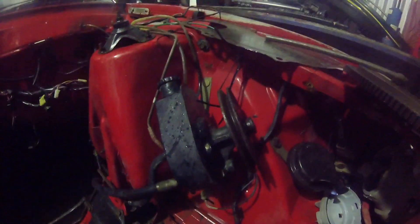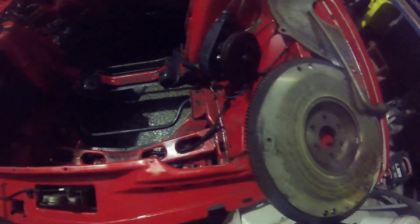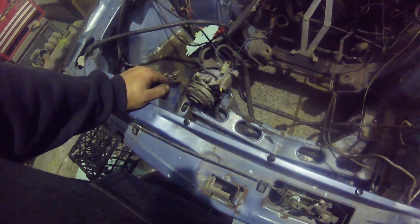We don't need to change the bracket because we changed the engine. The pump just needs to go into the other engine bay, which actually has to sit with an air-con pump. The air-con pump is under the alternator on this side of the engine, so that's excellent — we can have air-con and power steering together.